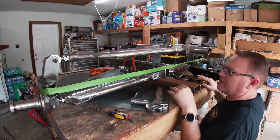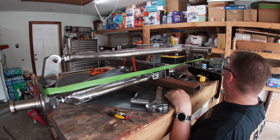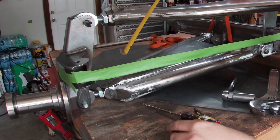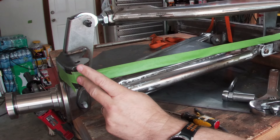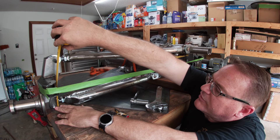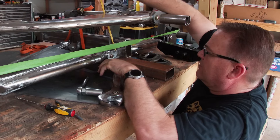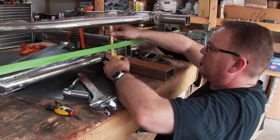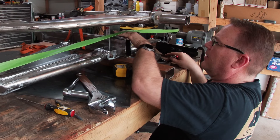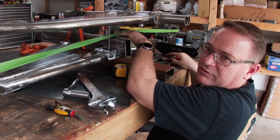The tape is just kind of giving me an eyeball. I already know this is too low — it's not going to be where this is. So what I did is I took a measurement from the center of bolt to the center of the steering here, where the tie rod goes. If I go center to center, it's about five inches. Dead smack five. So the thought is, if that's five, then this also must be five. See if that looks more like it's supposed to be — and that does. That looks a lot closer to what it needs to be.